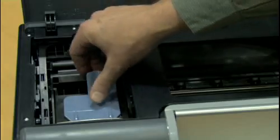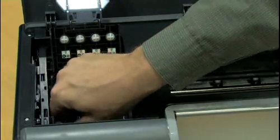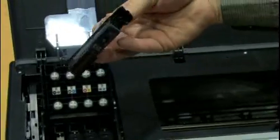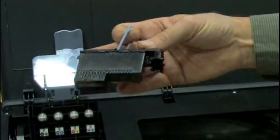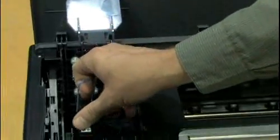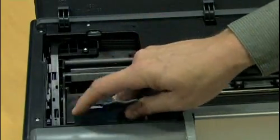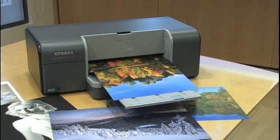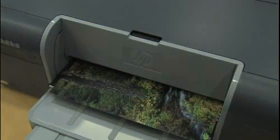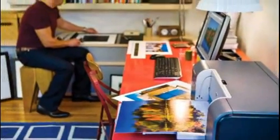On the B8850, as well as the B9180, it has customer-installable print heads. These are four print heads designed to last the life of the printer, put in during initial product setup. If for some reason a print head needs to be replaced, it's user-replaceable, so you don't have to send the printer in for servicing. Each print head snaps into place, and in the out-of-box process the printer automatically primes and aligns the print heads and performs a calibration. This is unique for products of this category — it calibrates at the factory, then calibrates again when you install the print heads, ensuring color quality meets the design standards.